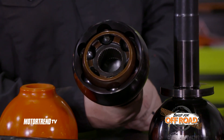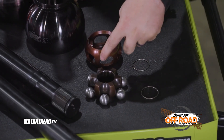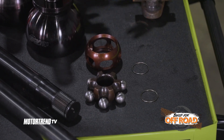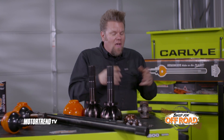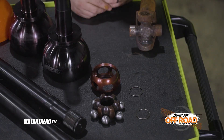Inside an RCV is what's called a constant velocity joint. We now have six points of contact throughout that entire turning circle, and when the joint turns — or the star on the inside turns — it smooths out that motion. What happens is you get a smoother output of power down to the tire and wheel. Anytime you are jarring a suspension or driveline component, that's when it breaks. So if we can smooth out that action, there's less chance that it's going to break.